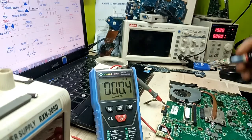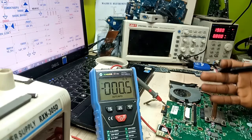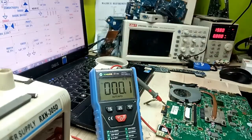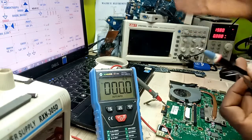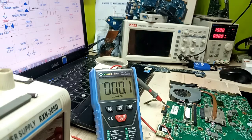I will ground that AC OK pin to communicate with the IC. These electronics communicate based on voltage. The AC OK signal also goes to the I/O. All they need from this point to confirm there is a charger is a low logic signal. If they get high logic — 3.3V — this motherboard will sense it as battery voltage, and it will try to power as if running from battery. Powering from battery and powering from adapter are two different sequences. That is the issue.